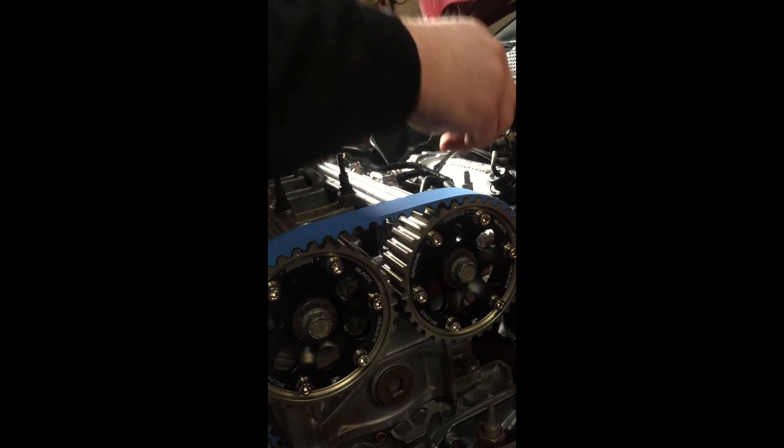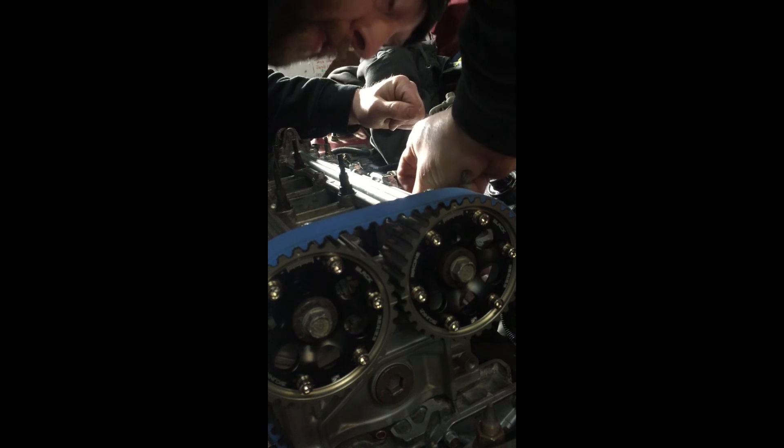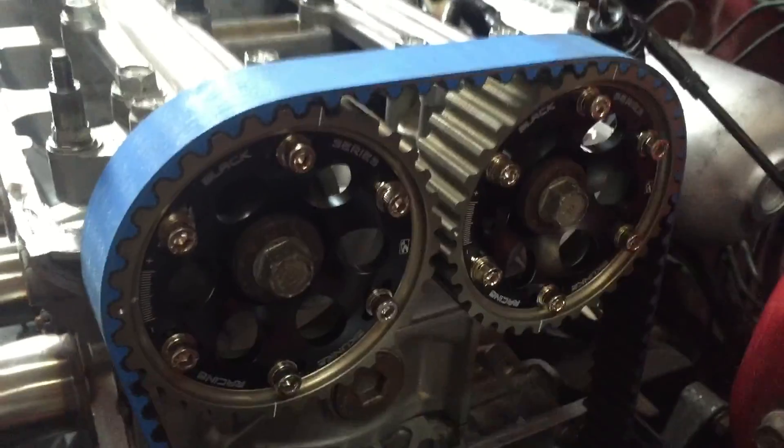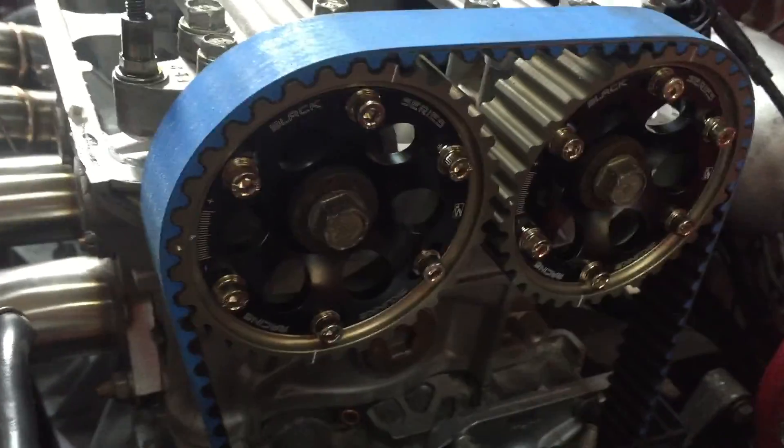Now, the next step of this is what people get confused on. These engines are reverse rotational. So where's our next spot on the firing order? What we're going to do is use a handy-dandy wrench down here. We're looking at our cam gears. I'm going to turn this bad boy over, which is actually hard on video, especially hard if you leave it in gear. So cylinder one will be pointed up here. Three. Four. And two. In this exact same manner that we just did cylinder one.